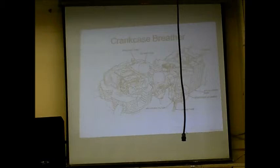Here's another graphic view of the breather. This time the breather tube comes off the top end and goes right straight back to the air box. The separator is built into the air box on the breather tube. Obviously, if you take the air box off and put individual pod filters on, none of this is functioning anymore.